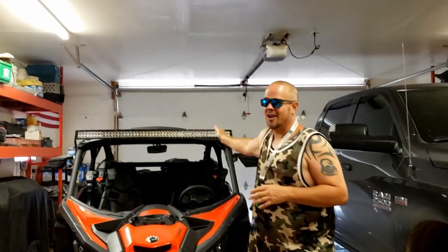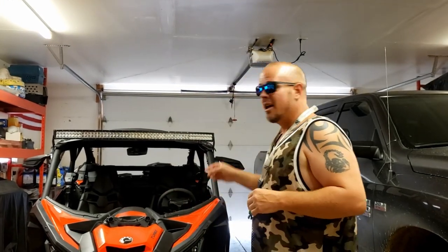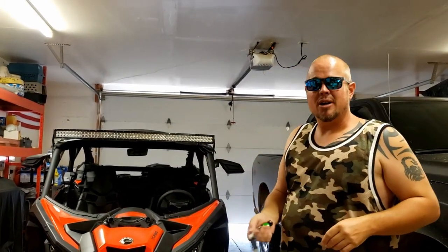Well, we've gotten to the end of the video. Conveniently, right before we want to do the final finale and show you the light bar turn on, we ran out of camera space — we literally cut off right when we went to turn the light on. So the light bar is already installed, everything's done, and you've gotten to see how it was installed. The installation is pretty easy and straightforward — it didn't come with directions, but the harness has your power cables on one side, the side that plugs into your light bar, and the side that goes to your rocker switch. Running it through the console and connecting it to those three individual components puts it all together.